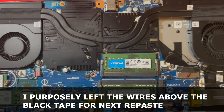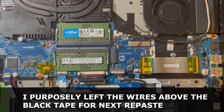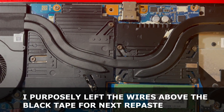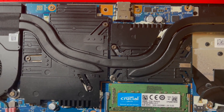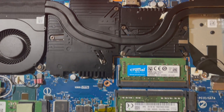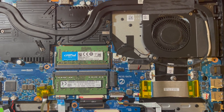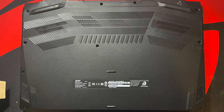When finished, apply your thermal pads to the rest of the machine and replace the heatsink. Connect all the cables to the fans, Wi-Fi Bluetooth module, display, and battery. Once you're done, give everything a once-over and make sure everything is connected. Everything looks good here. I used K5 Pro for the rest of the machine. Now attach the bottom, add the screws, and give it a go.